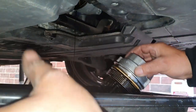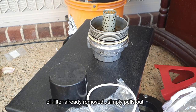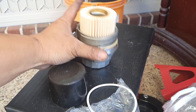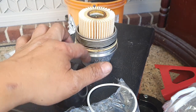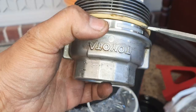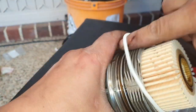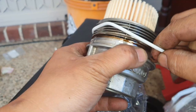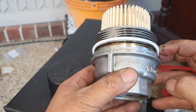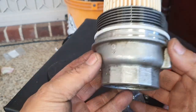We'll let that drain for a bit. Now grab the new oil filter — it also comes with a new O-ring. We've already removed the old one, so push in the new one just like that. Then we replace the O-ring on the cap: remember where the groove is, use a flathead screwdriver to get the old one off, grab the new one, and sit it straight back in the exact same spot in the groove.